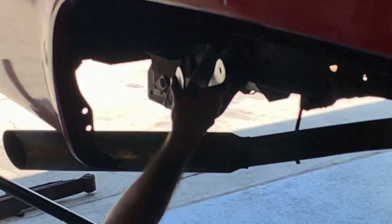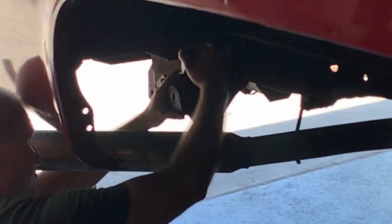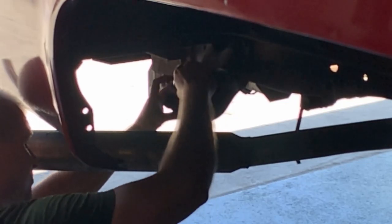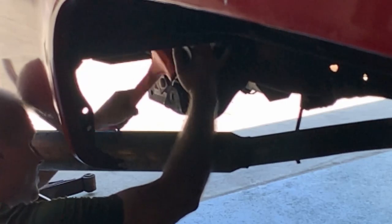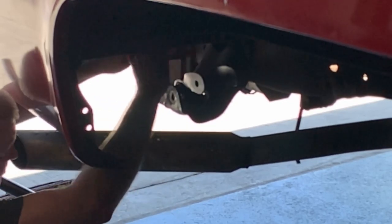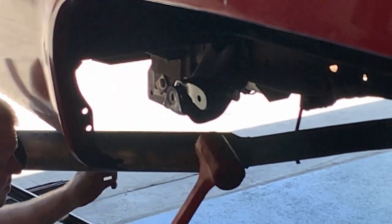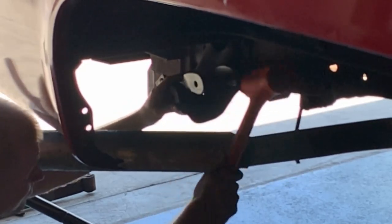Before mounting the spring you'll need to start with the shackle. This is going to require quite a bit of patience as it's very difficult to mount properly. A combination of rotating it back and forth on the teeth as well as using things like your mallet or even the tapered end of your crowbar will allow you to seat it. Once it is seated go ahead and place the bolt through, but do not tighten the backing as you'll want as much flex as possible in all the mounting points until everything is attached.